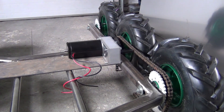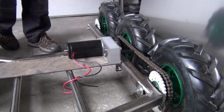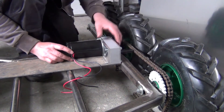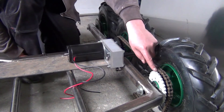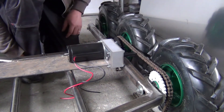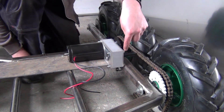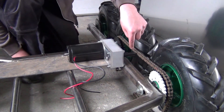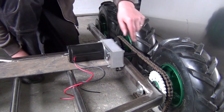I haven't really given a lot of thought to the placement for the motor so far. I think it needs to be right about here so there is space for the other chain. I will be driving the front wheel — probably put it a bit further forward. This bracket will have a smaller sprocket created on both sides. I probably need to manufacture a plate here which will allow me to move the motor back and forth, because the tensioning of this chain will be done by moving the motor — this tensioning is needed for the main chain between the wheels.